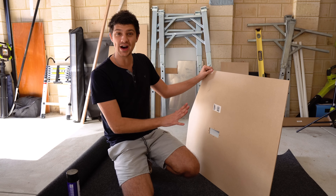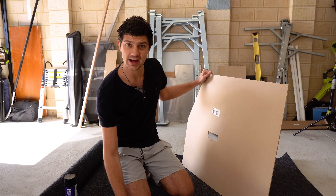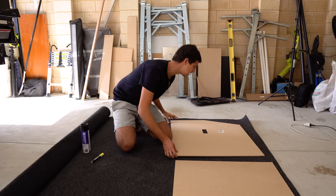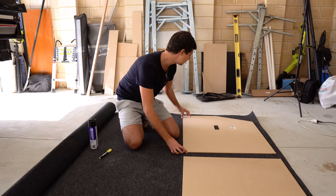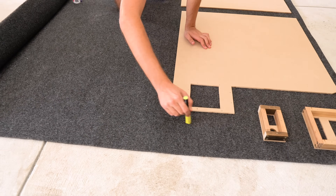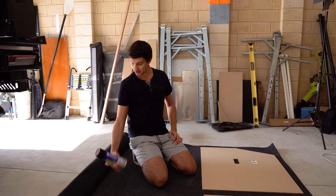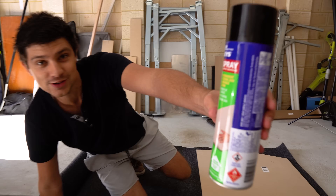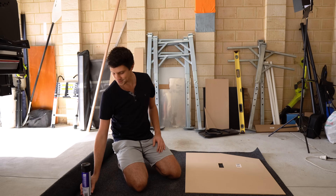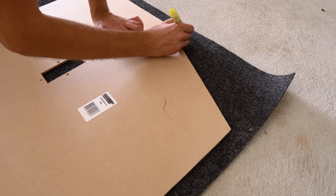My headboard panels are all cut down to size and they fit really nicely in the canopy. The next step is to attach some carpet to them. I'll lay the panels down on the marine carpet I bought from Bunnings, use my chalk marker to draw a line about an inch around the outside, then cut the carpet to size. I'll use Selleys Quick Grip Contact Adhesive to stick the carpet to the back of the panels — this stuff is really good for sticking carpet pretty much anywhere — then fold the excess around the back and staple it to keep it in place.